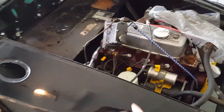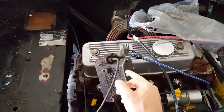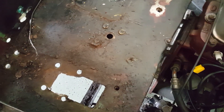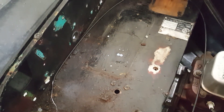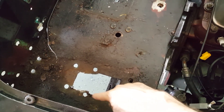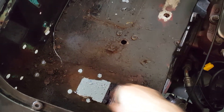The dual — sorry, clutch and brake cylinder. I haven't actually taken off the brake lines yet. I actually had to make a slightly different cut here just to free the pedal box. It was all so rusted and the bolts were just not giving, and the pedals couldn't come out unless it was just one unit. That's all going to be covered by the cover plate so structurally it doesn't make a difference. I could do a little bit of a rust repair panel there, but everything else has come away quite nicely.